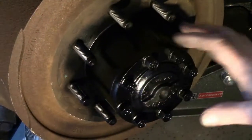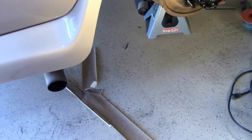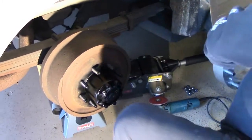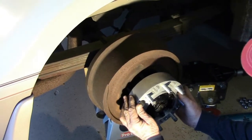After I got that smoothed down, I went over it with some 80 grit and got it relatively smooth. Then I shot it with some Rust-Oleum Semi-Gloss Black. This will probably skin up some of it as I put it back on, but it will protect the majority of the surface that I roughed up with my sandpaper.